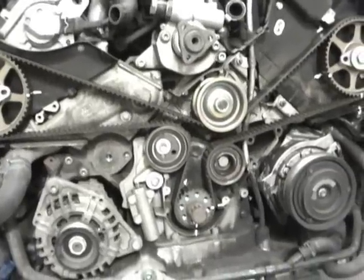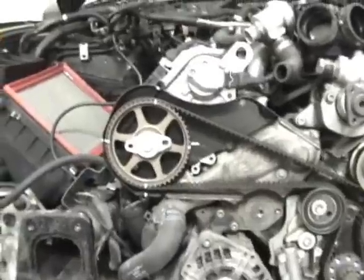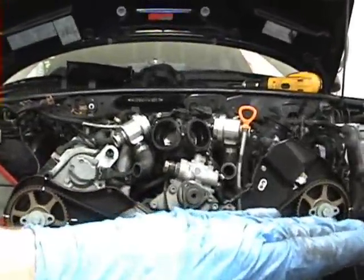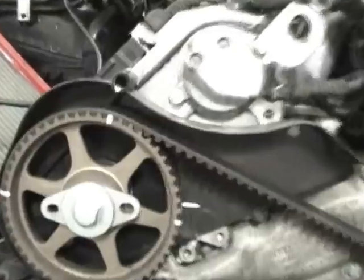So what you would do, if the belt was just yanked off and nobody paid attention, is you could just take a straight edge, you know, just a metal bar from here all the way across to the other side. So you'd have a straight edge that went all the way across like that, and you stood back and get those two cams flat with the big side towards the inside. You see a big hole, little hole, the big hole towards the inside. And you just lay a straight edge and get them pretty flat.